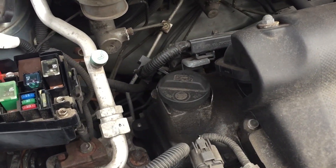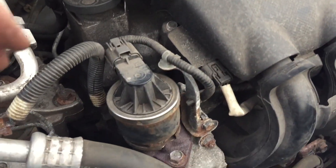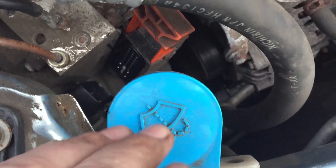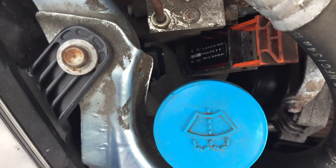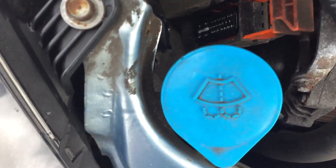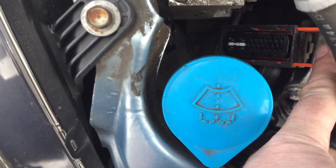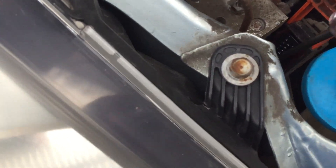What I then done was take the car for a run, and you can't actually feel the pump kicking in — nor with the functional test on the scan tool. So here's the ABS unit. I've disconnected the multi-plug. These are all roughly the same. At the back there are two big power pins and two big grounds, so it's a matter of checking them out. I've got my test light on the power lead — and you can see that's good.